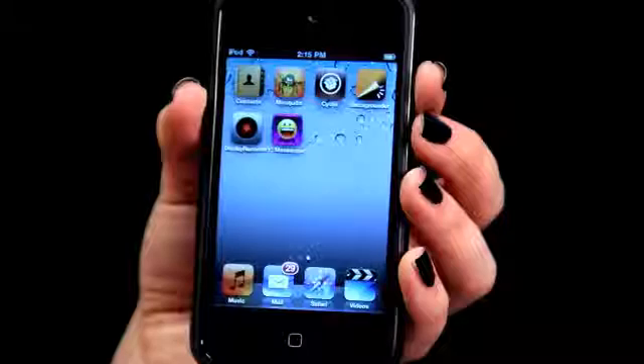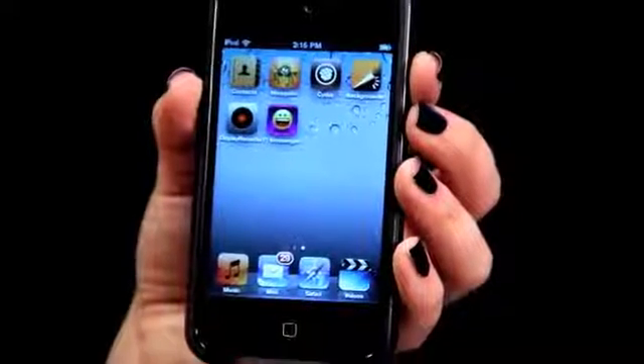Hi, I'm Liz Watts. I'm certified to work with small devices such as the iPod Touch. What we're going to talk about is DFU mode. Let's say that you have had a virus, or you have installed some software on your iPod that you don't want anymore, or you're having a really big glitch. Your iPod will not be recognized by iTunes — you can't get it to do anything except tell you to plug it into iTunes. iTunes can't recognize it because the software has been corrupted. So the final step to getting iTunes to recognize it is to put your iPod into DFU mode.